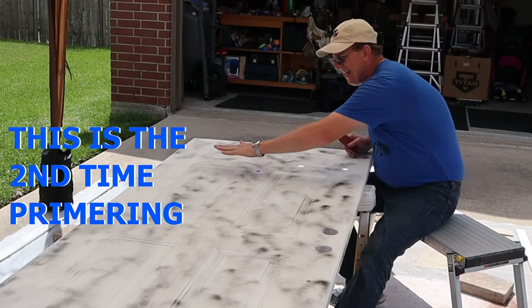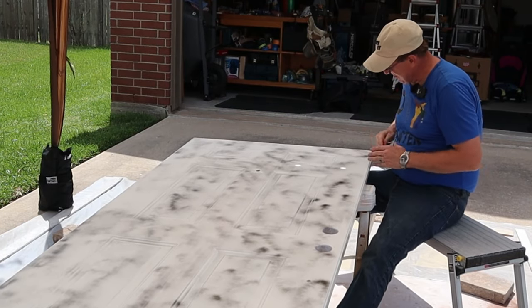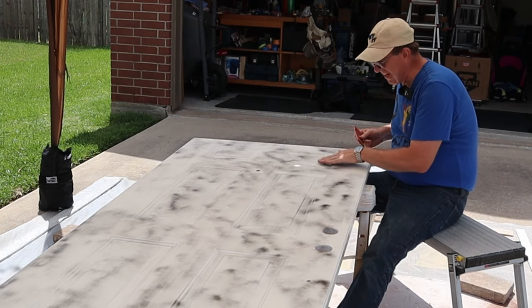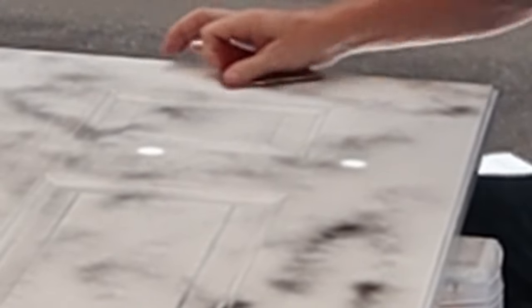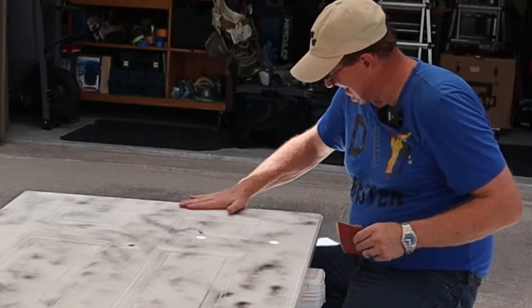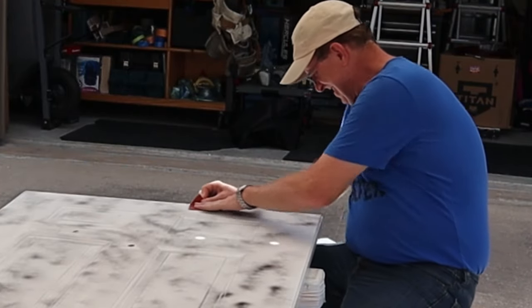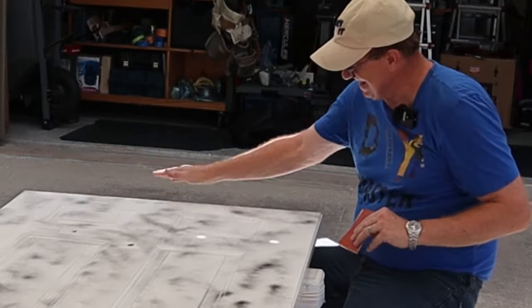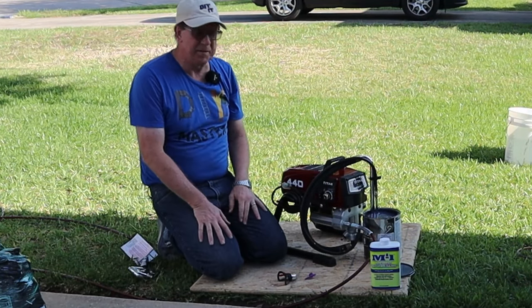It's all dried and I've already sanded that half. Basically what I'm doing is sanding until it's either smooth or the black guide coat goes away. When the black is gone, you don't want to go any deeper because the next thing after that is metal. It's really hard not to go through on the corners — I got a couple corners where I went all the way through. When you go through the black and it's just white, stop. After that I just wipe off the sanding dust, have a feel — beautiful. We'll finish the rest of this door and then paint it.